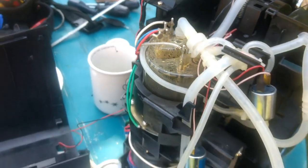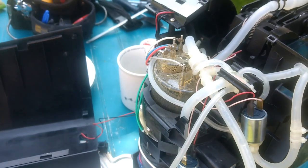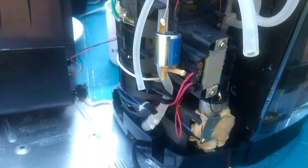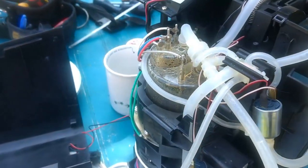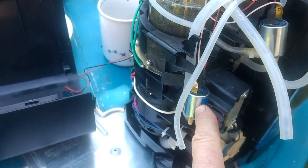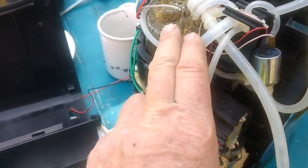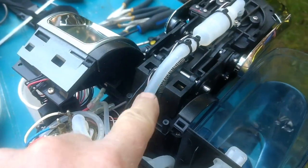As the water level rises, the air has to ventilate, and the solenoid opens up and allows air out of that tank. Once the tank fills up with water, the air pump kicks in and starts pushing air back into the water heater. The solenoid has to close so the air doesn't evacuate to the atmosphere again — it closes up, plugs the circuit, allows full pressure into the tank, and pushes water out and up through the machine.